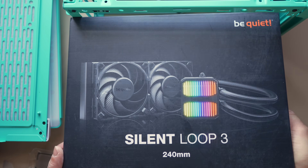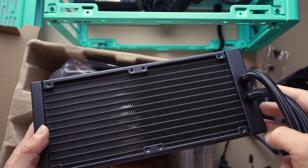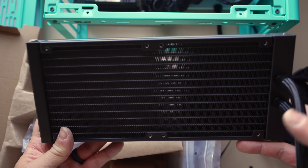That gives you some better headroom. These tested out to 2400 RPM, so it's close enough. This comes in 240, 280, 360, and 420mm. The unit tested here is the 240, which features two 120mm fans. The ensemble features a 27mm thick radiator, and this 240 — meaning two by 120mm fans — is 277mm long.